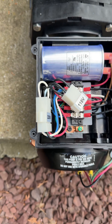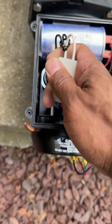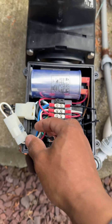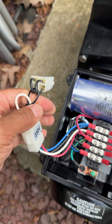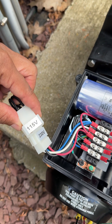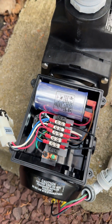You will find that it comes configured for 230 and 115 voltage. If you need to swap them out, it's actually pretty easy — you just remove this piece right here. It clicks right out. This part then plugs into where that was, and now you have it wired for 115.